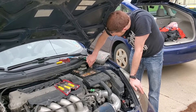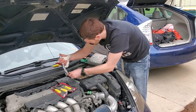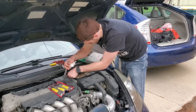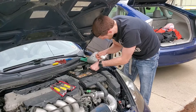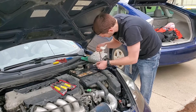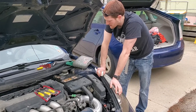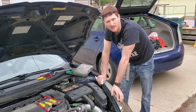I just kind of wiped off all the soda and stuff from there so there's not a lot of soda building up. Now she's good to go — just tighten her down. You've got some fresh leads there and they look a lot better. There's no more corrosion on there, and that's what really helps with getting more power to the car, having less issues with starting. The battery is good there. It took me about 10 to 15 minutes — really easy, real quick. Just do it when you've got a little bit of time.